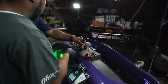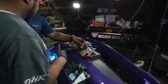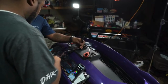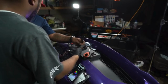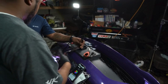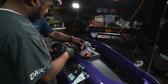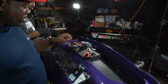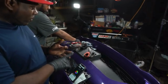Because some of these, when they start to have problems, like you got RGB, red, green, and blue. Yep, so those are the channel outputs. So red and green might work on one leg or one whip, and blue might not. So you might have all of your lights except for blue on one leg. So you want to double check them so you don't jump to conclusions thinking something is wrong with the software or something. We just checked each channel on these legs to make sure it did the RGB, red, green, blue, and white.